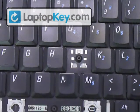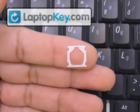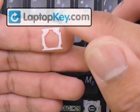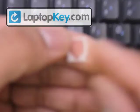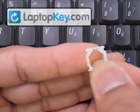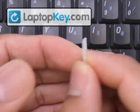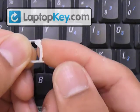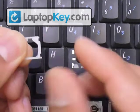Let's get the large piece first. You can see this has two small pins at the top corners and two larger ones at the bottom corners. The small pins go wherever the large hook is — if the large hook were at the bottom, you'd turn it around. The large hook is at the top in this case, so we leave it this way. Make sure not to put the whole piece upside down, because it looks the same but the mechanism won't work. You have to feel underneath the vertical bar — there's an extra bump there that faces and touches the keyboard. If it's one smooth piece from top to bottom, that side faces away from the keyboard.